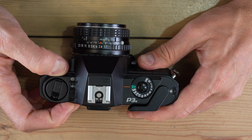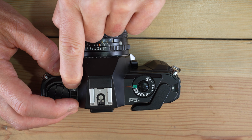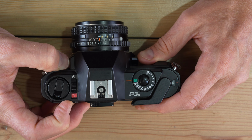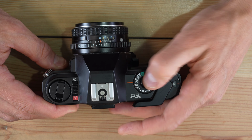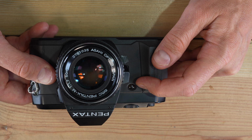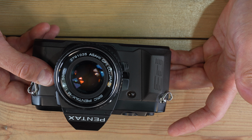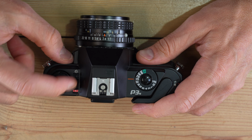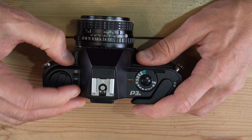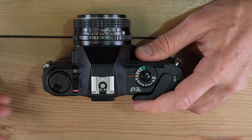This is your power switch. This is off, this is on. If you want to use the self timer, you can push down on the top of the power switch and slide the switch all the way up, so you can then see the ST indicator there, and that will allow you to use your camera's self timer. When you use the self timer, the red light on the front of the camera will blink. It's a 10 to 12 second self timer, something like that, and at the end of the self timer time, the camera will take a photo. If you don't push this down, you cannot get into the self timer. You have to push this down in order to access the self timer. The switch is designed so you can only switch between off and on and can't accidentally get into self timer with a properly working switch.